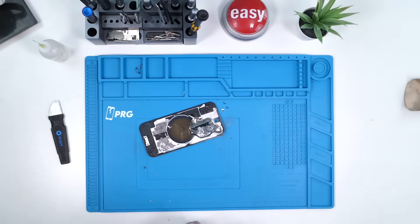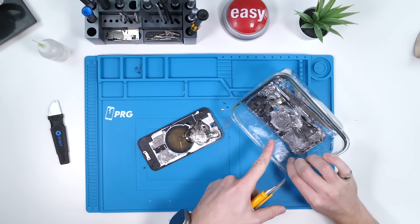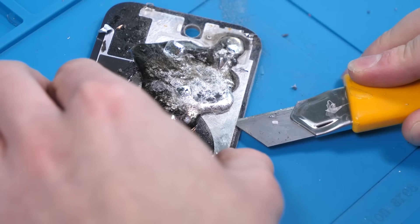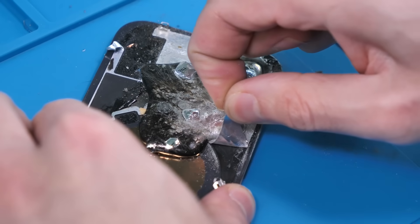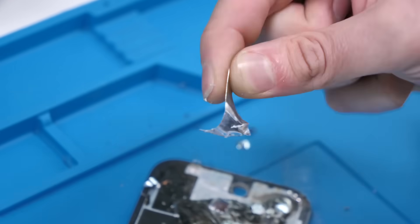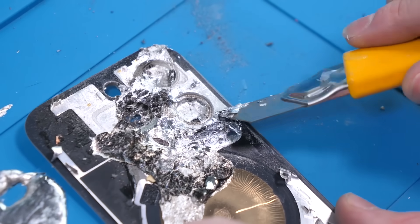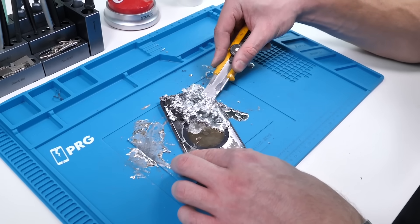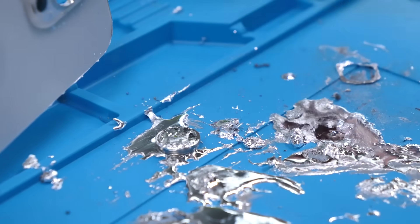We waited about 15 minutes. I have my old experiment here — the iPhone 14 back glass — and we'll be pouring the gallium back in there once we're done to reuse it. Now I'm going to take our blade and see what happens if we get under. Holy crap — this is just peeling away! The aluminum is incredibly weak right now; we can just remove it like paper. You don't understand how satisfied I am because removing this plate usually takes hours. We poured a little more gallium to help speed up the process, and the camera bumps came out like it was nothing, but we were left with a huge mess.